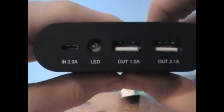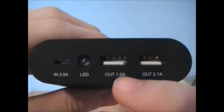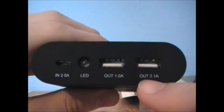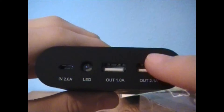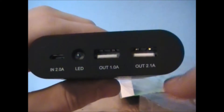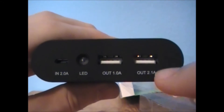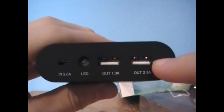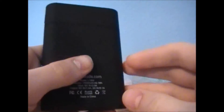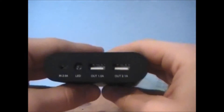On the top it has a one amp output and a 2.1 amp output, so you can charge two different devices — one at average speed and the other at two times as fast. If you're in a rush and want to charge your cell phone, charge it on the 2.1 amp port because it will charge significantly faster. Also, tablets require 2.1 amp charging, so you can actually charge a tablet with this device. I'm pretty sure this can give an iPad about one full charge and around 12%, though I don't have an iPad so I'm not certain.